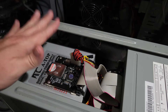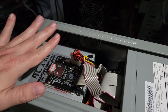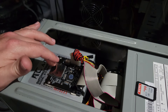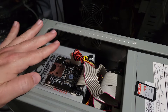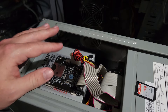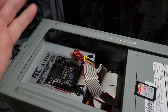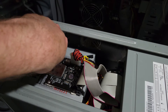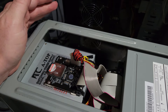So I had one disc and only one working 360K drive, because one of the two in the XT doesn't work. In the end, the easiest solution was to boot into MS-DOS — whichever version you're going to use — in a more modern machine, and just take the SD card you're going to format, put it in this adapter. Because it's basically the same identical adapter just soldered onto that card, all the settings for the virtual heads and cylinders will be the same. Whatever is set up on this card carries over to the XT to IDE adapter. Once you get that set up, you just move the SD card over to the other system and away you go.